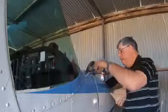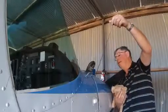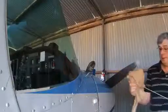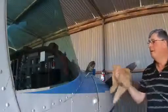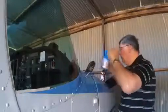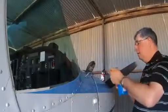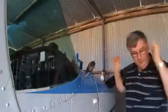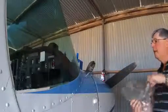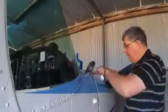Ordinarily with regard to oil, we go through about a litre every 10 hours — that's considered to be pretty standard. If you're going through much more than that you can get concerned. The engineers themselves say 10 to 12 hours on one litre is quite good; anything more than that you need to start getting things checked out.